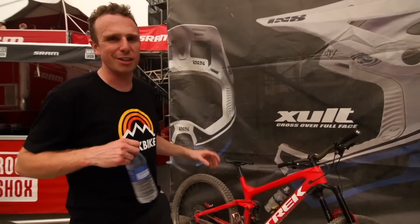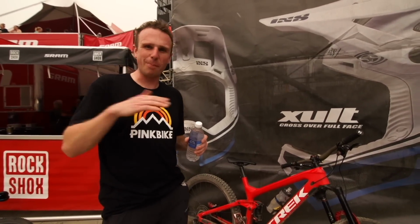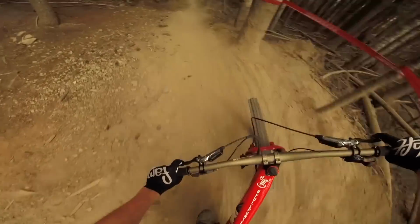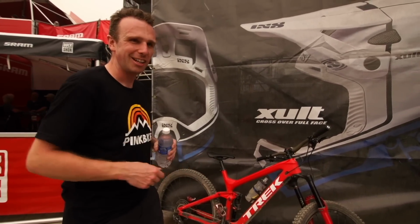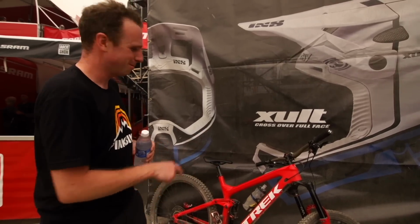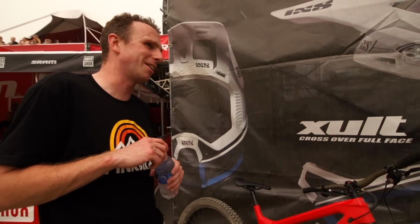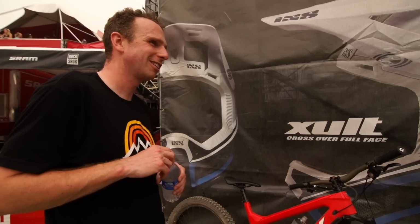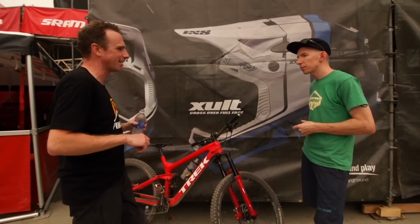And it was so good having a slow rebound. Felt way more composed going over the roots, I'd say. I was worried that before, when I slowed it down a click without the token, it was having way less traction and slipping out. I think it's going to tell me I need more token. I think it's going to tell me I need more ramp on the fork. But way less, like barely any hand cramp or anything.